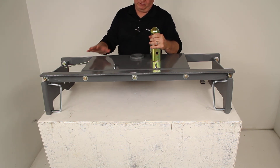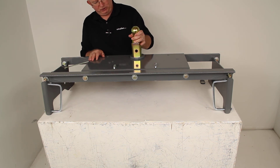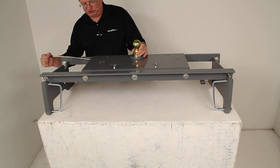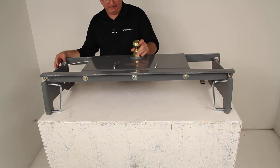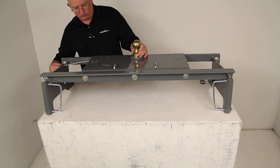To show you how that would operate: if you are going to tow a gooseneck trailer with this, just go ahead and drop the ball into the opening. Your handle on the side — just twist it to release it — that would release the pin. That 5/8 inch diameter pin would lock this ball into place. If you are done towing and just want to store the ball, pull it open.